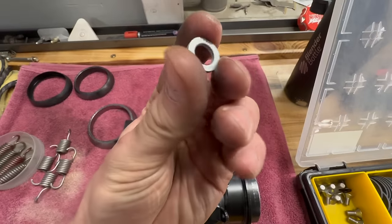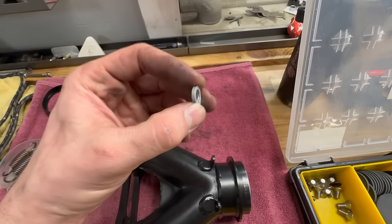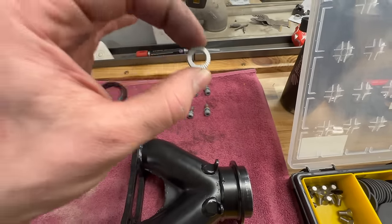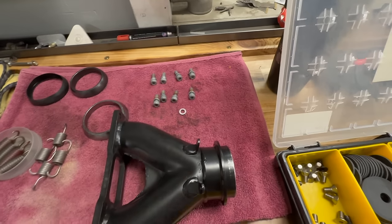So we're going to switch over to these Nordlocks or wedge locks. This is what on the XS chassis we used to have to use. This was kind of the only thing that would keep the Y-pipe bolts tight on the older 800. I don't want to have to pull this apart with the boost and all that stuff. I'm not even gonna mess around. We're throwing wedge locks on it along with the proper Loctite and the proper torque. Shouldn't have any issues there.